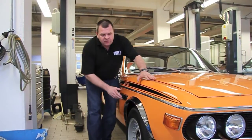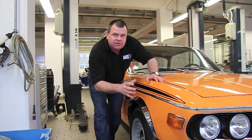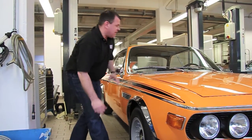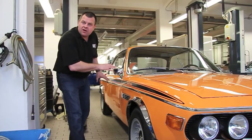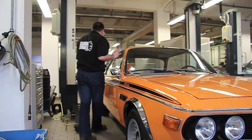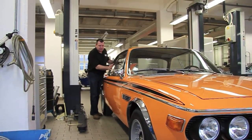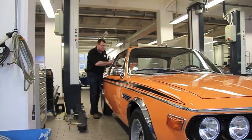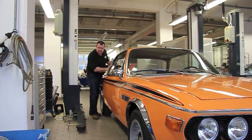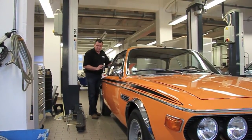This car being one of the first of the carburettor cars, and really as BMW meant the lightweight to be, it didn't feature a front bumper, and it featured the very lightweight plastic fibreglass rear bumper. On these early true lightweights it also featured plexiglass, which was of course then used in race cars as well. So the rear windows were fixed — they didn't go up and down — with plexiglass rear screen.